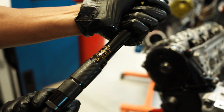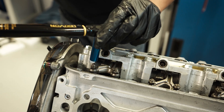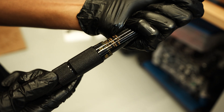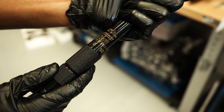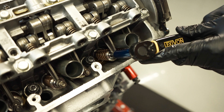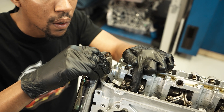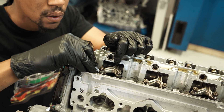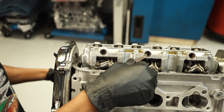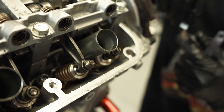The exhaust side on these engines runs a really low torque specification. This is a J35 Z6 engine where we're going to be running a different torque specification for intake versus exhaust. On the intake rockers they recommend 20 newton meters or about 14 foot pounds, and on the exhaust side we're looking at 14 newton meters and about 10 foot pounds. Not all J series engines use a different torque specification for intake and exhaust, but for this particular engine Honda does recommend it to be different. Once it's all torqued to spec, go ahead and check the feeler gauge again to make sure it still feels good and the screw didn't tighten or loosen further.